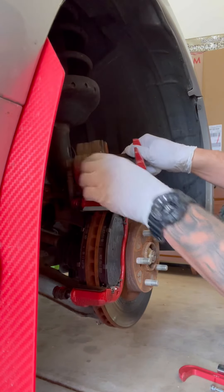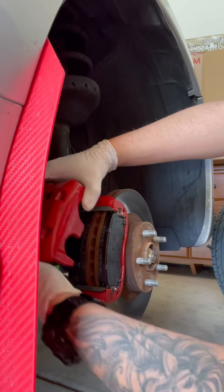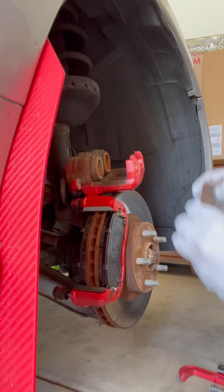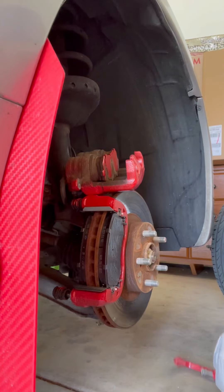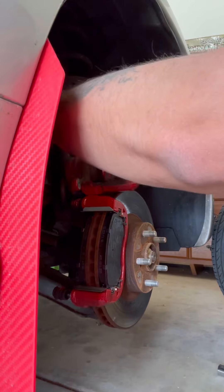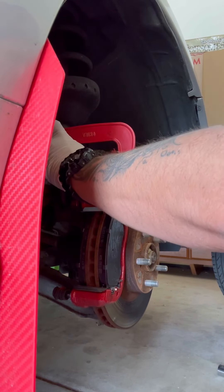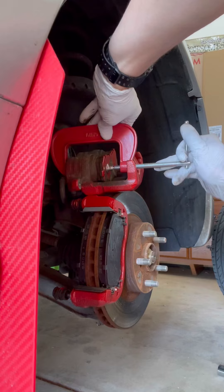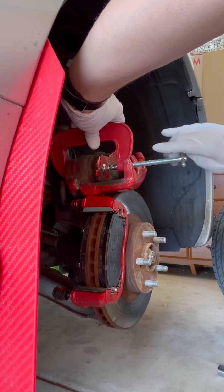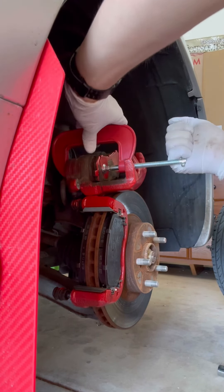The last thing we need to do is compress the pistons in the brake caliper. They're compressed to fit the size of the old brakes, so if I try to put it over the new bulky ones it's not going to fit. This is where we use our c-clamp. I like to take an old brake pad, line up the c-clamp with the end at the back of the caliper and the push end on the brake pad, and tighten it — that pushes the pistons back into the caliper making more room to fit over the new brakes. There are two pistons so you want to do one on each side.